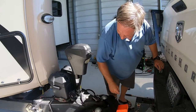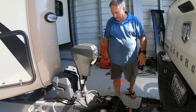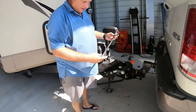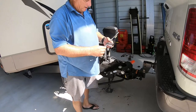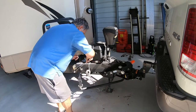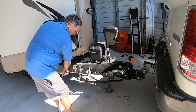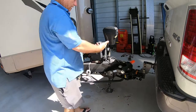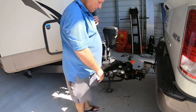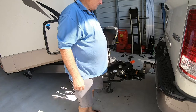I need to remove this two-by-four now — I'll just take it out. The hitch is ready to go. All I have left to do is adjust using a T-handle sliding ratchet, an inch and an eighth, that goes right inside the Strattec. I pull as needed and adjust both sides, and you're ready to pull. That's it — it makes hooking up a lot simpler. Because the Strattec is pulling up on the head, it goes in pretty much every time.